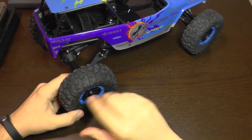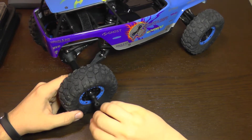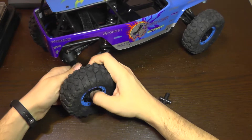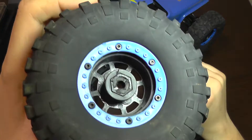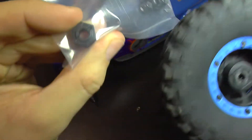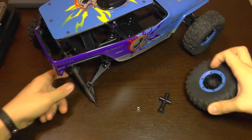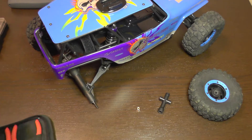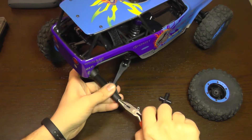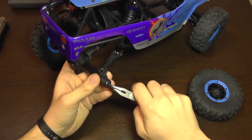I'm going to start by taking the wheel off with the wrench and you will see what problem I have. If I take the wheel out you can see how the hex is looking — this is how a new hex should look. It's completely stripped and even some bits of plastic are hanging from it, while the pin won't come out easily because it's really bent up.